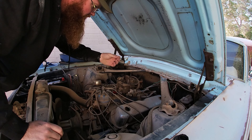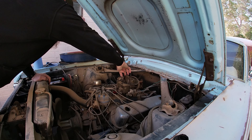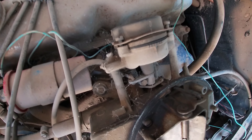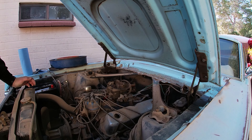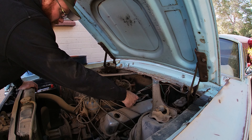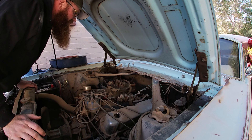The choke has been open on this, so hopefully nothing terrible will happen. Oh no — all of the electric choke screws are backed out, all three of them. Not great. And it's stuck, but I'm pretty sure I just broke the accelerator pump gasket that's in there. So we don't need that right now.